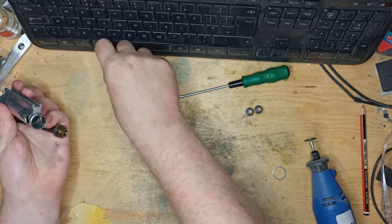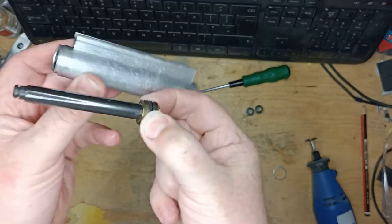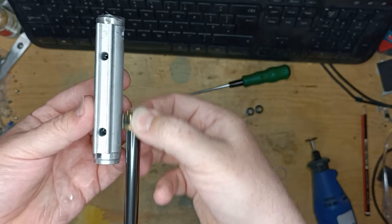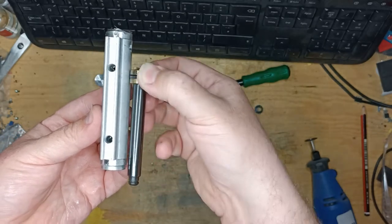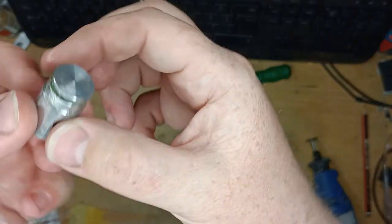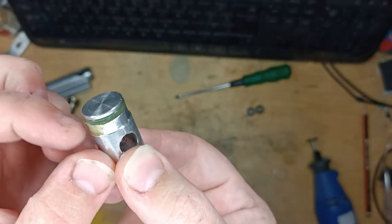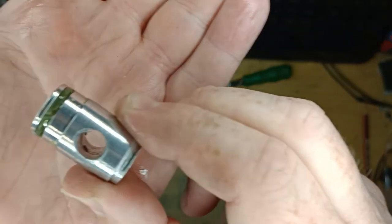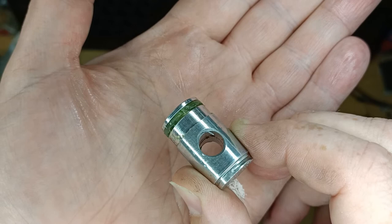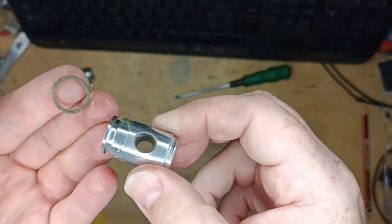Really got it this time. Let's sit that down there. This is the plunger. Ordinarily you'd be used to seeing that in there, and as the car injects and removes fluid, it causes this to simply slide back and forth — that's really all there is to it. And the aluminium bung at the back — let's have a look at them. I think that might be the remains. Hopefully you can see where the O-ring deteriorated. They simply failed, and that is why all that fluid is coming out.